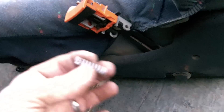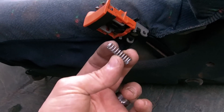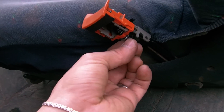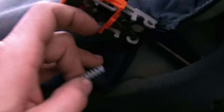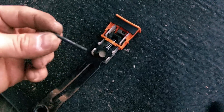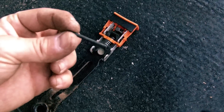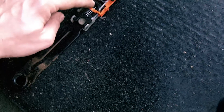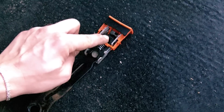This is the one I'm going to use as a donor. Fortunately, it seems that it's just a case of a missing spring, which I managed to source from the other buckle — I just need to squeeze it in there and lock it against the little clip. Except the missing spring, there was also a little metal bar missing, which has to go in there to lock the actual seat belt buckle.